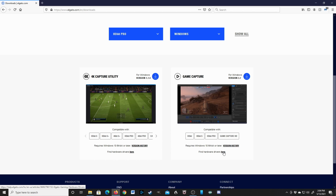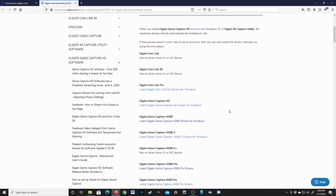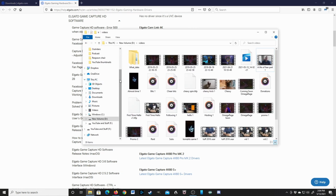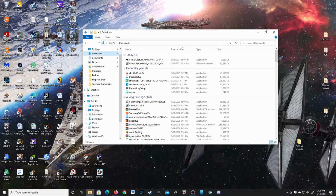Go ahead and click here, and then you look for your capture device drivers. Mine was right here. You click on it and get the latest ones. No, this is not mine, sorry, I told you wrong. This one right here, the HD60 Pro. This is the one I had to do. So you download it, and of course you'll have it right over here. Where's my downloads? There we go. From there you double click on it, and then install the drivers. Once the drivers are installed, you're going to want to restart your computer, just so the capture device will be seen on your computer.